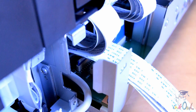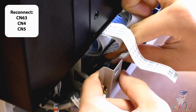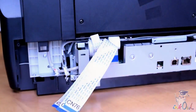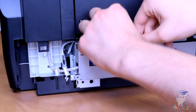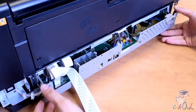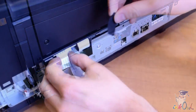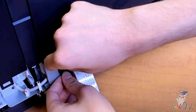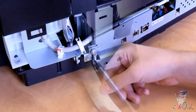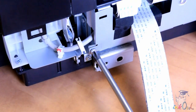Step 6: Tuck the 3 unused ribbon cables back and reconnect the cables CN63, CN4, and CN5. Step 8: Twist the 3 ribbons as shown. Step 9: Slide the drawer back into place until snug and replace the electrical tape removed earlier. Step 10: Secure the drawer by tightly fastening the 4 screws removed earlier.